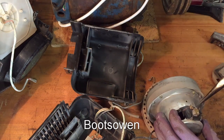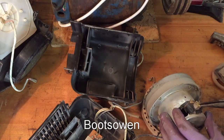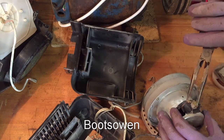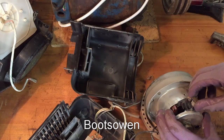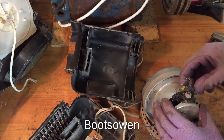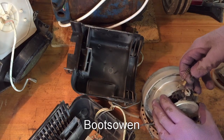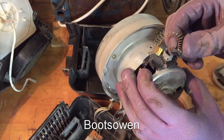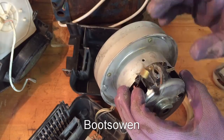These don't look like they're meant to be replaced because they've got single-time twists on them. Well, that's your problem there — brushes are worn down to nothing. If you can see that. They're absolutely dead. Like there's nothing there. It's right down to the copper.